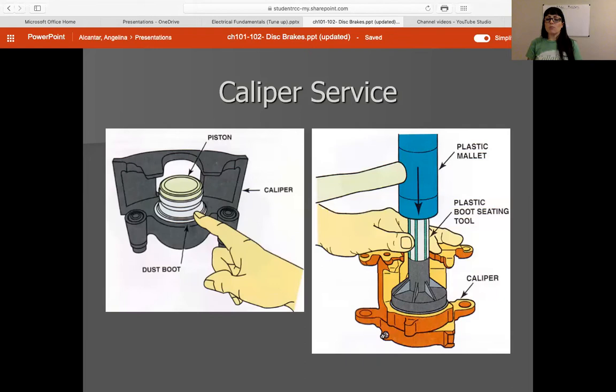Once you go to put the piston back in after the seal has already been put back in, you may need to put the dust boot on the piston at this time — it really depends on the design. There is a special tool to insert the piston, but you don't necessarily need one. It is important that you get that piston perfectly straight in. If it's not perfectly straight and you try to shove it in, you will gall it and damage the piston. Make sure it's really straight and then squeeze it down, rocking it back and forth until it's partially in the bore — from there it can't be crooked. Then, using your hands, just squeeze the piston back into its bore. Double check that your dust boot is sitting the way it is supposed to be sitting and you're done. It's ready to go back on the vehicle. You're going to need to bleed the vehicle because there's a whole bunch of air in the back of that piston after you're done rebuilding it.